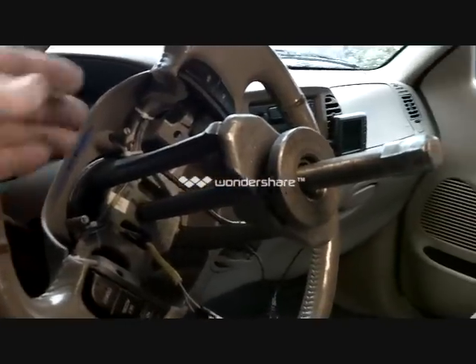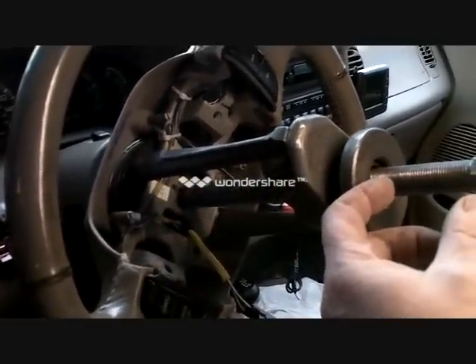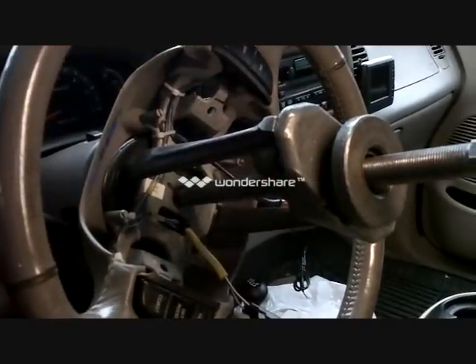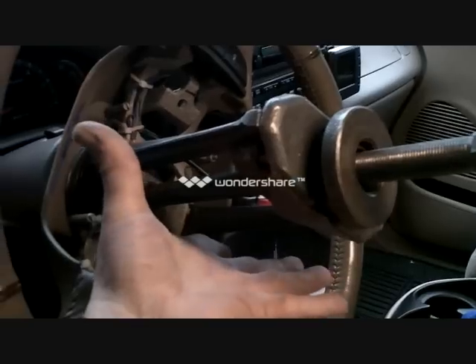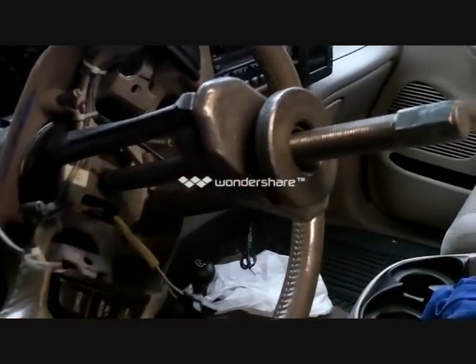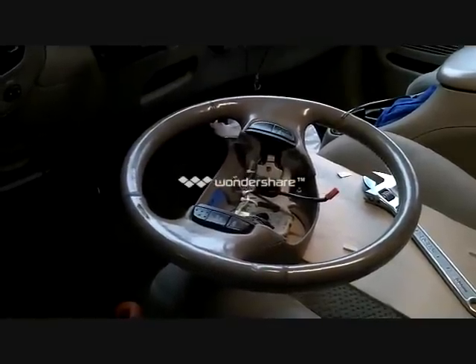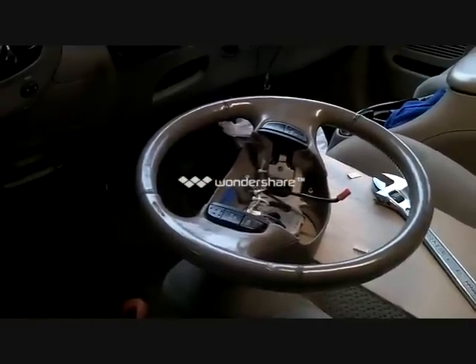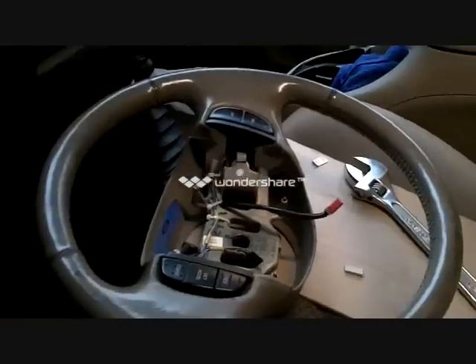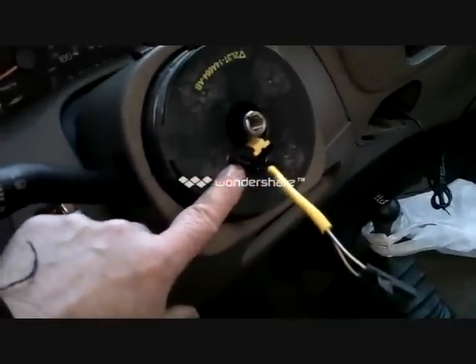There it is set up — you can see I have a lot of room to pull, it's set up nice and tight on the steering wheel column. If you're not familiar with pullers, you tighten this down and it keeps the arms from spreading out. There it is off — it took a little bit of pressure and wasn't moving so I just let it sit and then all of a sudden it came loose. The WD-40 definitely helped. Then to remove the steering wheel you have to undo this plug on the steering column, and then you can just take it right off.